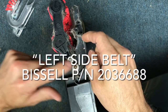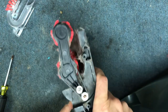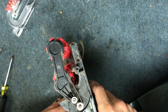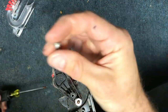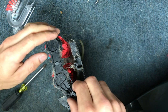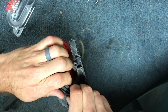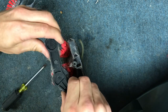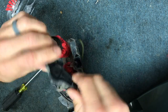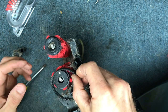In my experience, most of the time it's the short belt that is the one that's breaking, and this is going to just depend on what you find when you open up your machine. So the first thing we can do is take off this screw right here — this is a stainless steel screw that has kind of a washer built into it, so you want to set that aside. Then at that point this plastic cover here is going to lift out of place, just like that. And now you have access to your belts.